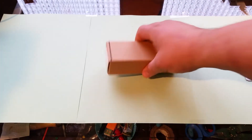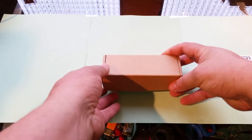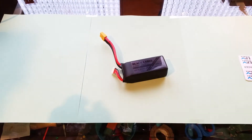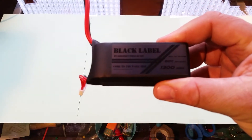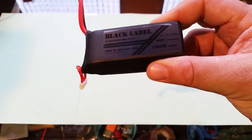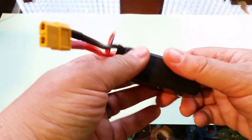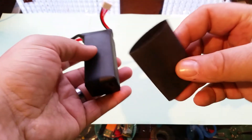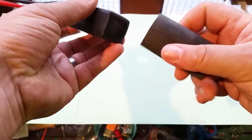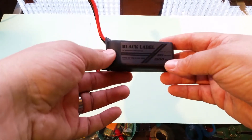And on to the coup de grâs — we've got a nice little brown package here. 1300 milliamp hour, 4S, made in China. Let's open it up and take a look. So we have the Black Label by Indestructible Quads, 1300 milliamp hours, 90C. The label is very dark — that's kind of what they're going for. This has a very thick shrink wrap on it and I really like that. It's heavy duty, takes an impact, and it's abrasion resistant. Excellent.